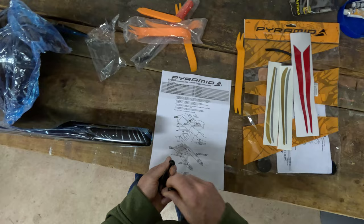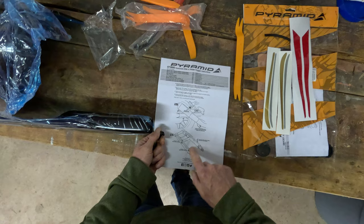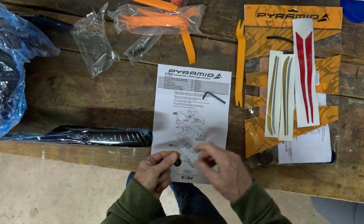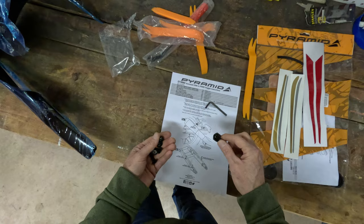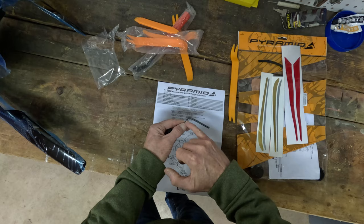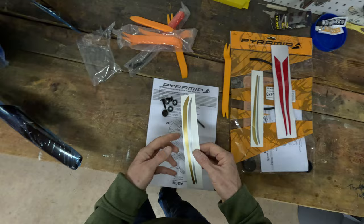The hugger instructions are fairly straightforward — a blown-up picture of the rear swing arm showing two fitting points where the OEM hugger attaches. This aftermarket hugger fits in those same two places. On the OEM hugger there's a third plastic push-down clip, which isn't on this one — it shouldn't make a difference. The instructions say you might want to loosen the exhaust mounting to get the old one off the swing arm, so we'll see if I actually have to do that.